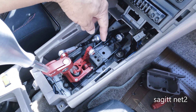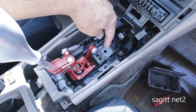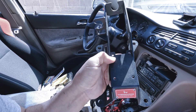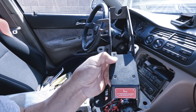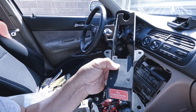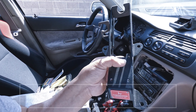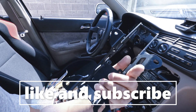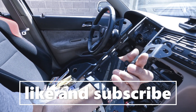That's the only reason why I use the OEM shifter plates — it's because of the rubber mounts. Be careful, this thing is so easy to get stripped out. If you ever remove this, make sure you are on there squarely, because otherwise you're gonna end up ruining the threads. But no biggie — you can always put a nut behind it.